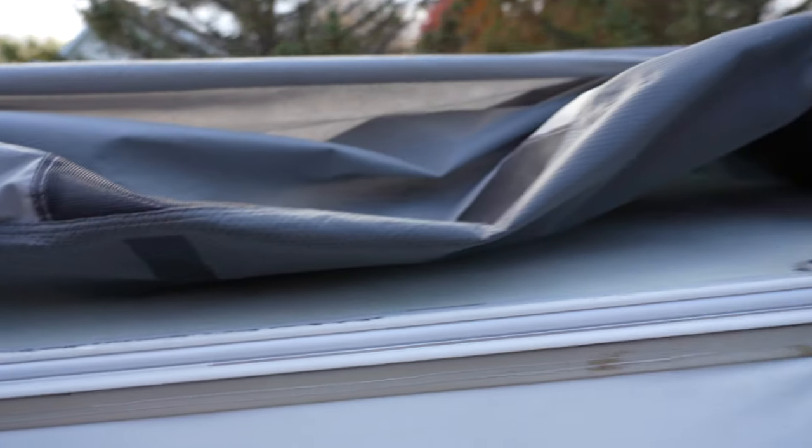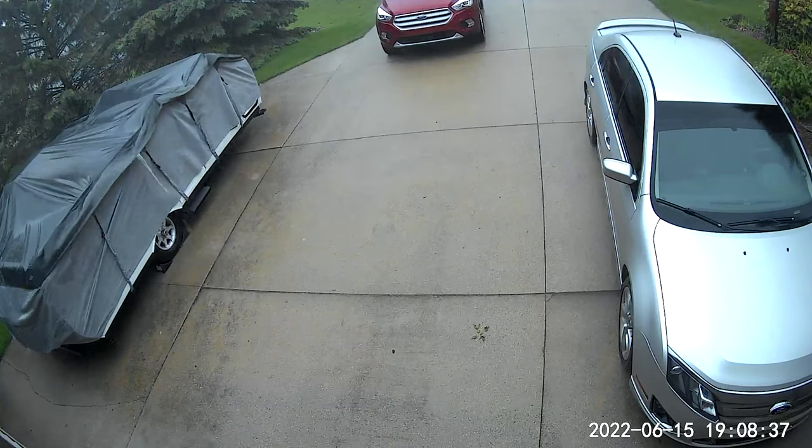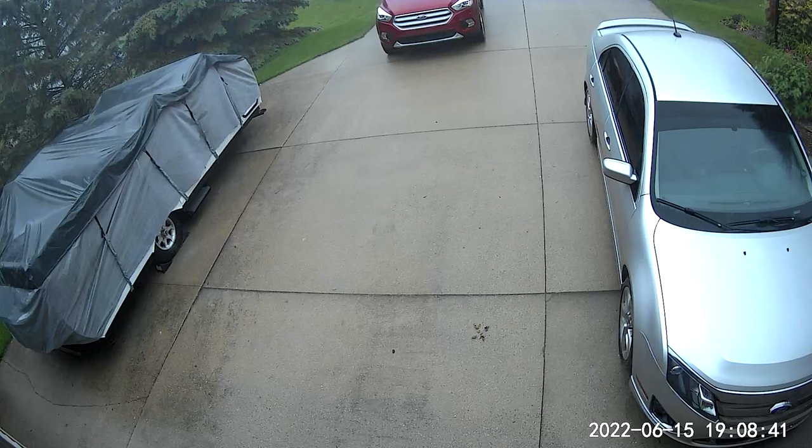The other thing — and this was really helpful with the roof rack — I just took a spare piece of lumber and put it right in the middle of our roof rack, and that way it prevents pooling in the middle. Without that two-by-four there, what we ended up seeing is that rainwater would catch in between our two crossbars on the roof, which was annoying — I'd have to come out and toss the cover up and down a few times to get the water to not pool. So those are two modifications: the Gorilla Tape, and a plywood board or two-by-four if you have a roof rack, just so it gets a nice slope and you don't have any rainwater pooling.